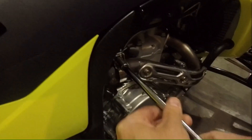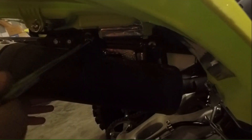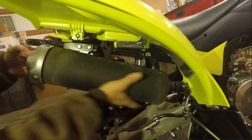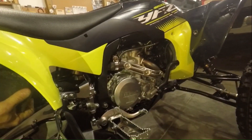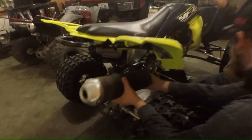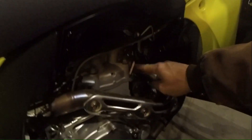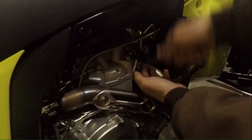You're going to want to loosen up that bolt right there as shown, then move to the muffler and take off those two bolts that hold it up. You want it just kind of hanging out loose like that, and it'd be handy to have someone or something hold the muffler up while you unhook it from the rest of the exhaust. Then you're done with the muffler and you'll see those bolts right there on the header — take those out and take your header out.